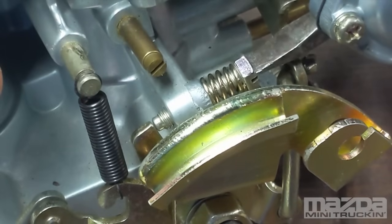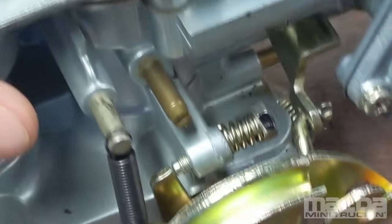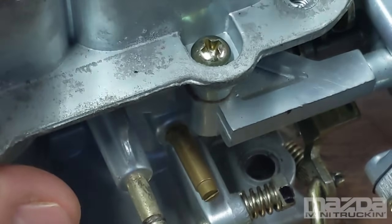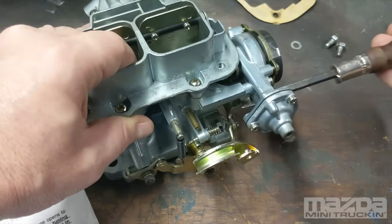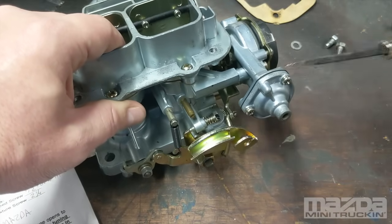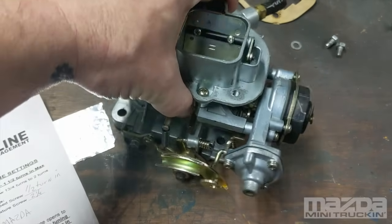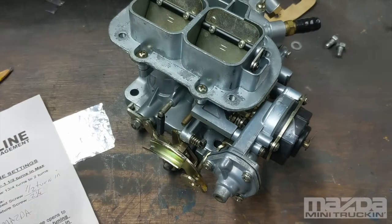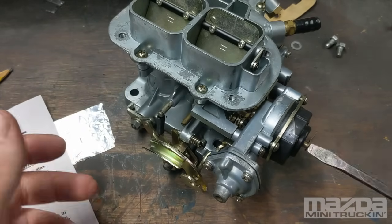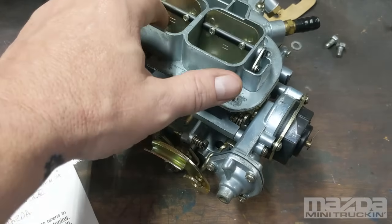I had mine marked just before one and a half turns. At one point running this carb, I think that was about 850 RPM or so. If you do almost one and a half turns in, you should be able to have a decent idle to get started doing the rest of your tuning. You'll just have to get your tuning set a little, get your mixture set a little, then run back to your idle adjustment and back to your mixture to get it all dialed in.